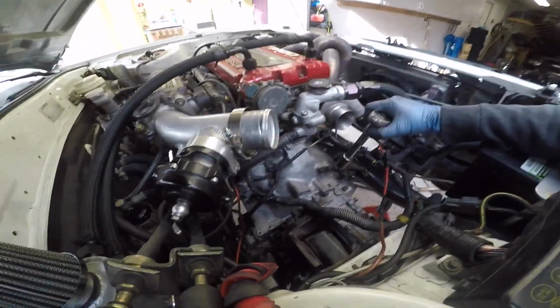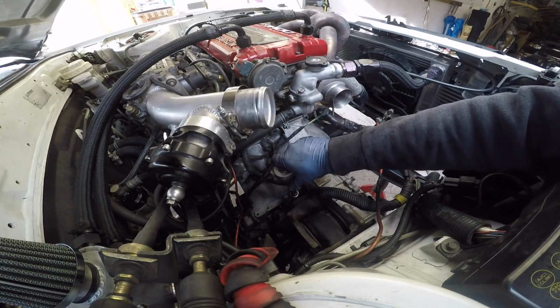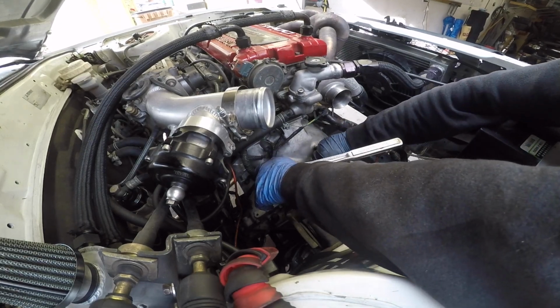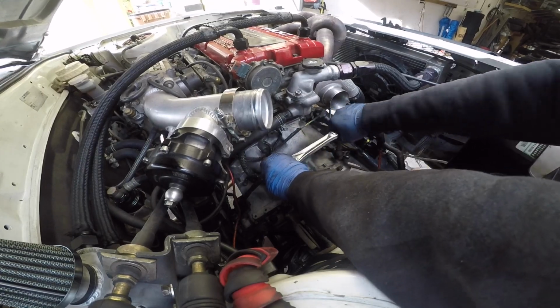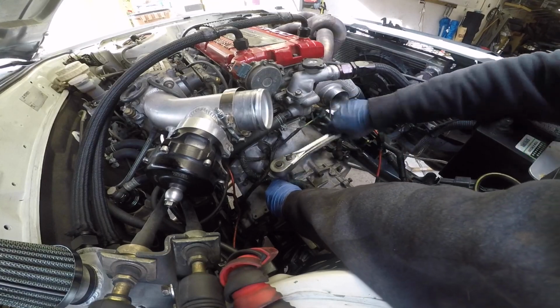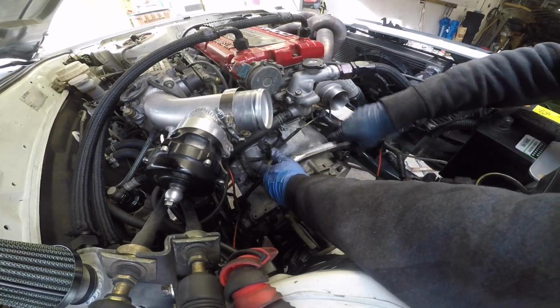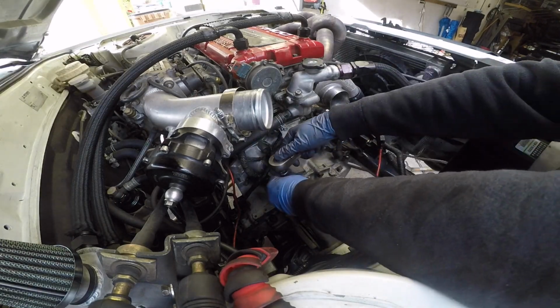Okay, got that back bolt out. Now I'm going to actually just take off the mount completely. I think that's how I did it. And that back bolt was a 13mm. Not sure what it will be for you guys. Could be 13, or I don't think that one was the OEM bolt. So, guess you'll find out when you do it. But don't forget that back bolt.